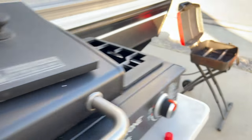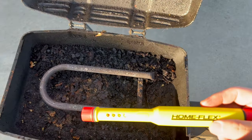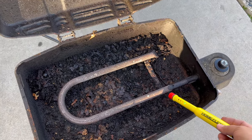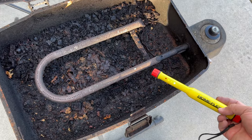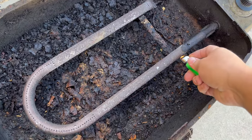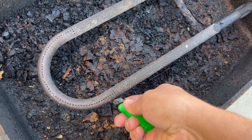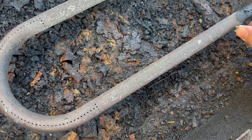I'm gonna leave the griddle on and go try the grill to see if there's gas. I've got my tester here — it lights green, that means no gas leak. Oh, there it is — see it goes from red to orange, so there is some gas. I try my sparker — that doesn't work — let me try with the lighter. You saw that, it kind of wants to turn on, but that regulator does not let it turn on. You guys can see that.